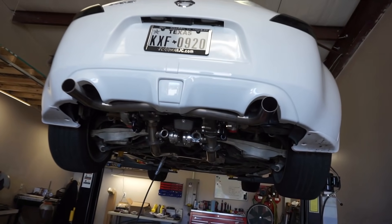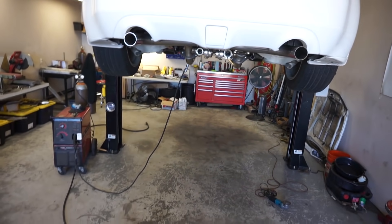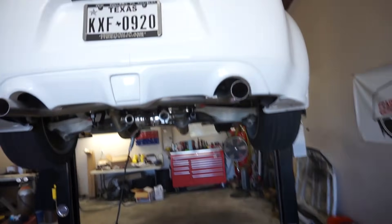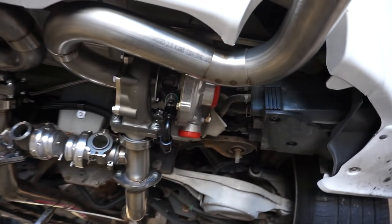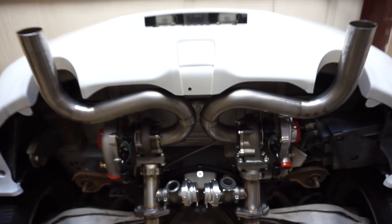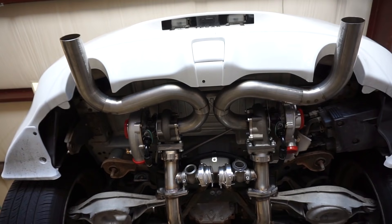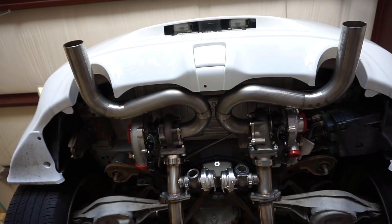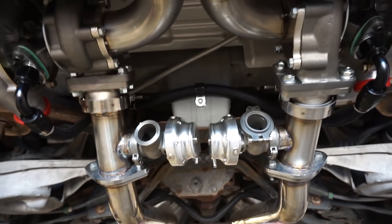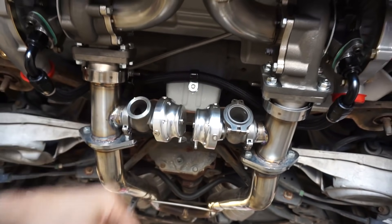Check it out — we were able to mock these up. We tried to kind of center the exhaust in the hole so in case we wanted to do some outlet tips, we'd have room for the radius. I feel like it came out pretty good. We ended up using a few pie cuts here and a few more there, and then one in the middle to make them kind of spaced nicely. I always wanted to do something kind of like that and it barely fits because of how close the turbos are together, but I'm extremely happy with how it worked out. Next we're gonna figure out how to deal with the outlet of these wastegates.